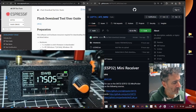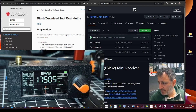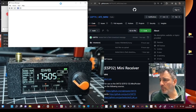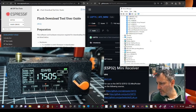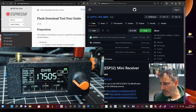Turn on the device and plug in the USB cable. Right-click the Windows Start button and go to Device Manager so you can find the port number. Double-click Ports, scroll down — mine is COM 34. So we've got our COM port number.